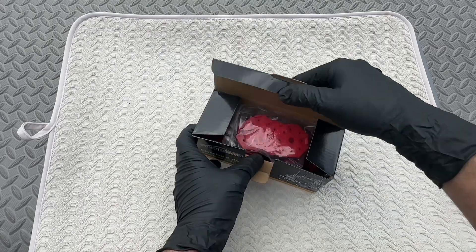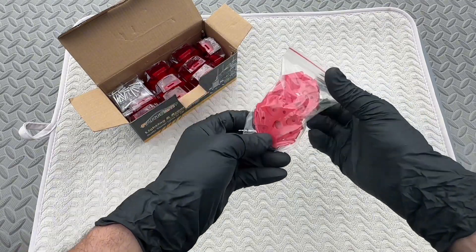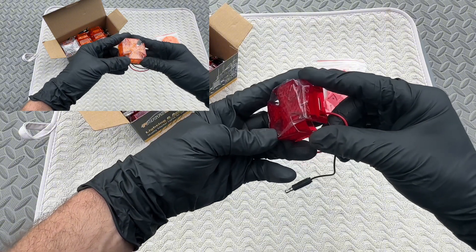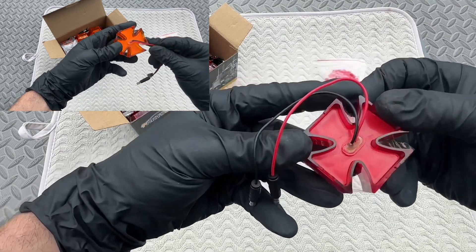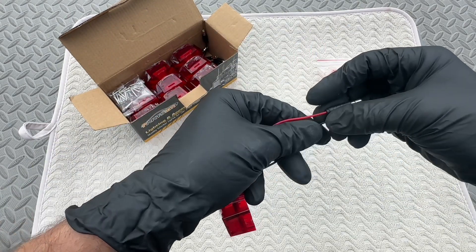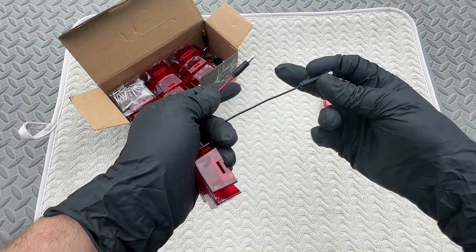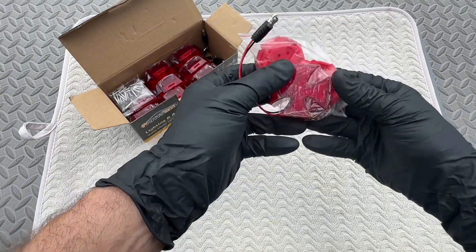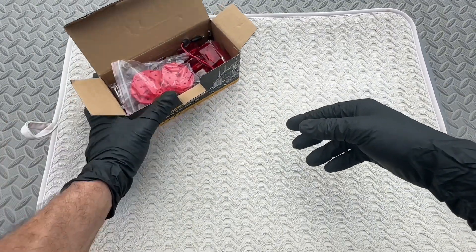This box contains 10 pieces of 2-inch cross-design LED lights. This bag includes the mounting plates that will mount to your vehicle. Each light measures 2 inches by 2 inches and just over three-quarter inches in height. Each light is fully waterproof with ultrasonic welding and weather-resistant silicone. The red wire is 12 and 24 volt and the black is the ground. The lights have a bullet-style plug so it will be plug and play if your vehicle is equipped with the female plugs. Each light has 12 LEDs that draw 1.3 watts.